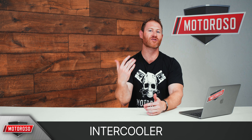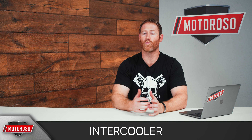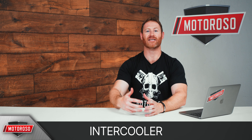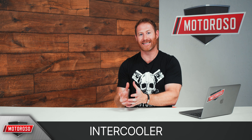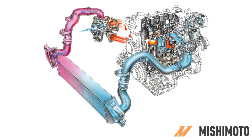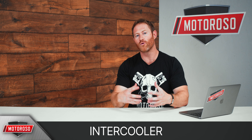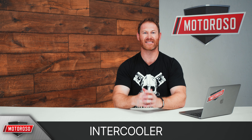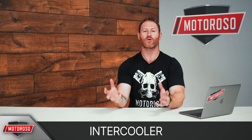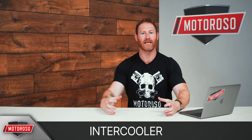One of the most important modifications you can make to your N54 or N55 engine is an upgraded intercooler. This is critically important especially on the N54, which tends to run a little bit hotter because of its twin turbo setup. Your turbo gets very hot because it's being spun by the exhaust gases — basically flames shooting out the back of the engine — spinning a turbine which compresses the incoming air. That hot air then passes through a chamber with fins that cool it back down before it reaches the intake manifold. If you don't cool that air down, you'll suffer from heat soak, because that air is too expanded and too hot. The cooler the air is, the more dense and oxygen-rich it is, the more compressible it is, and the better combustion you'll get.